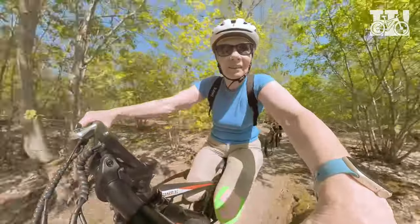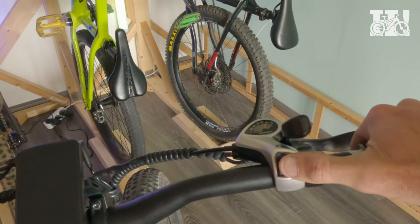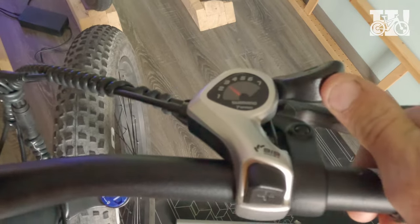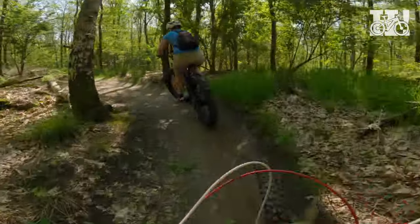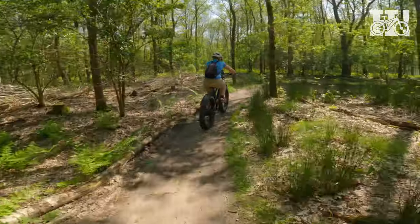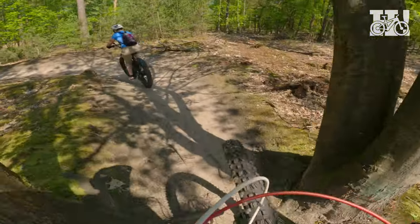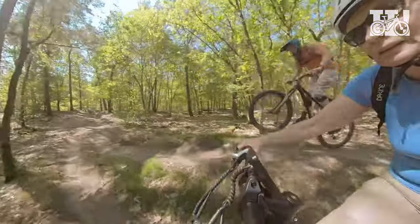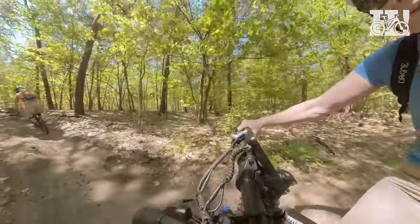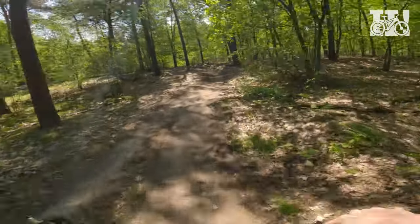The shifter is a bit, well, an odd choice. I get that on a budget bike every component has to be cheap, but I don't see how a shifter from the top of the bars is cheaper than one underneath. It's for a reason most bikes have the shifter from the same side of the bars as your thumb. Speaking of the bars, this brings me to the next issue — the bars are just too small, even to the point that my mother noticed this. Especially with a bike this heavy, you want all the leverage you can get to maneuver it around. I don't see how an 800mm bar would make the bike more expensive, yet it ships with a 650mm handlebar. You can always cut down wide bars if that's what you prefer, but making them wider is unfortunately not an option. I now have to recommend anyone who buys this bike to get wider bars and a shorter stem, basically adding 50 to 100 euros to the bike.